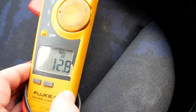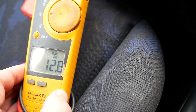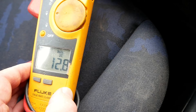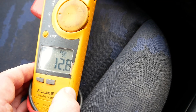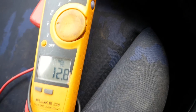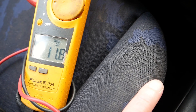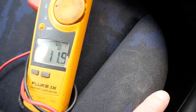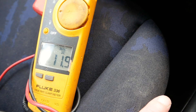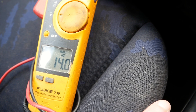I've just hooked up my tester onto the battery — it's showing 12.8 volts with a new battery, new starter, and new alternator. Now I'm going to test it for the first time, just make sure the alternator is charging the battery properly. Hopefully it will get up to about 14 volts. I do expect to see a drop in voltage initially as the car starts and draws current. It drops down to about 11. All that initial hard work has been done and now the alternator will start picking up. There she goes — fantastic result!